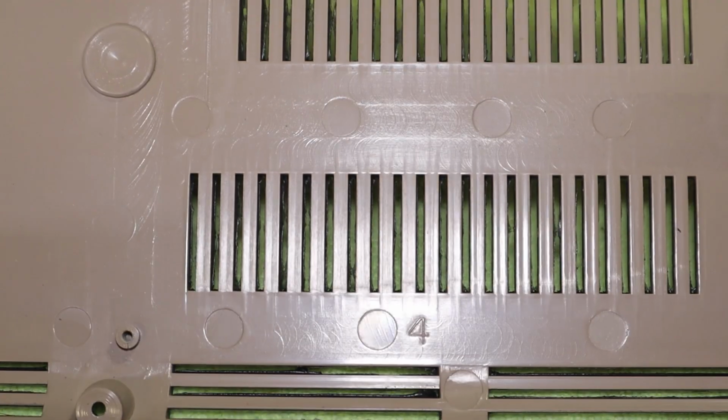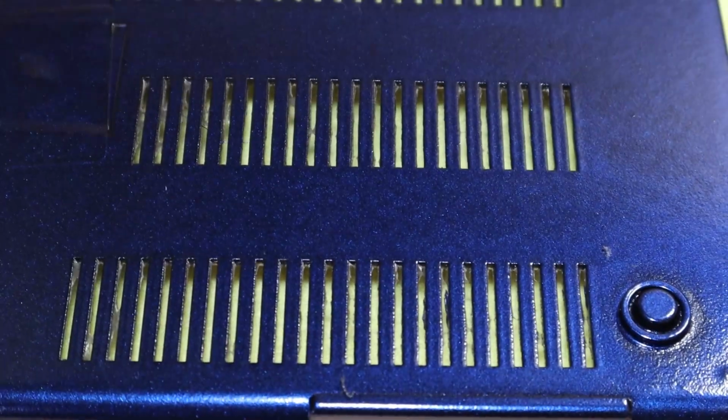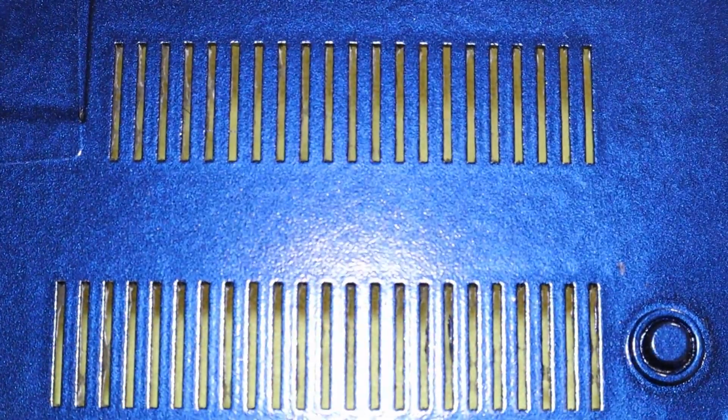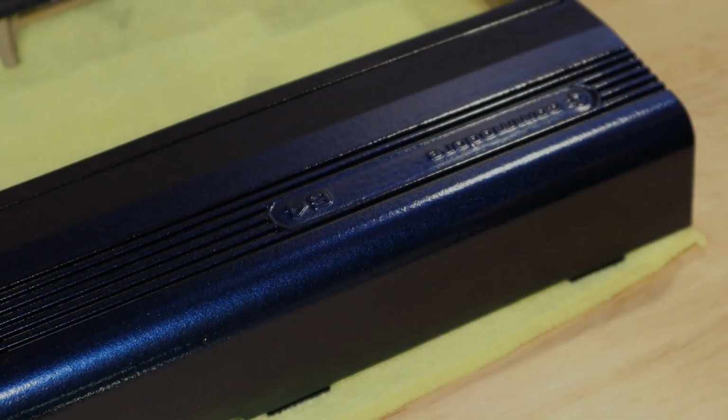One thing that didn't come out as well as I would have liked were the vents. The dip adhered to the masking tape, and removing it caused tears, resulting in a few jagged edges. Next time, I may try cutting up a polyethylene bag and taping the material over the vents, which should prevent overspray while also keeping dip from bonding to the backing.